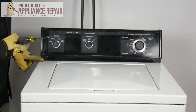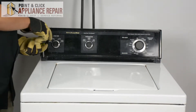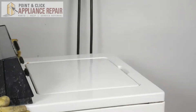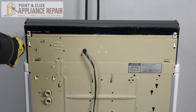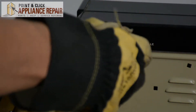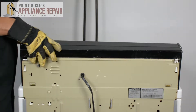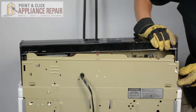We're going to take a Phillips head screwdriver and remove the two screws holding the control panel on the front side. Now we're going to have to remove the other two screws on the back, again with our Phillips head screwdriver. Now that you've got those screws off, you can remove your control panel — it should just pull right up. Just push forward and pull it right up.